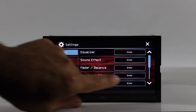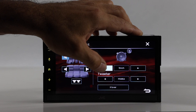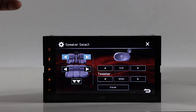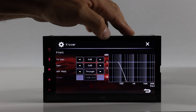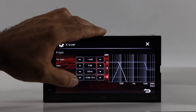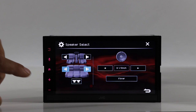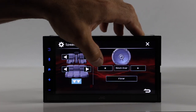Balance and fade are straightforward. Under speakers and crossovers, you can select the type of vehicle — say a compact car — then choose where the speaker is located, such as the lower door area. You can select speaker size from 3.5 inches up to 7x10, tweeter size as small, medium, or large, a tweeter crossover, gain adjustment, and a high-pass crossover for the door speaker with slope options of 6, 12, 18, and 24 dB. I'm really liking the DSP here. You can do the same for rear speakers, and for the subwoofer you can choose sizes from 6.5 inches up to 15.